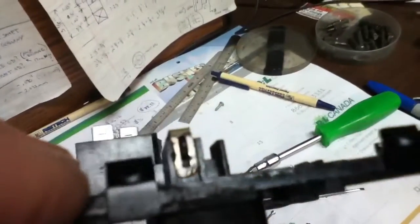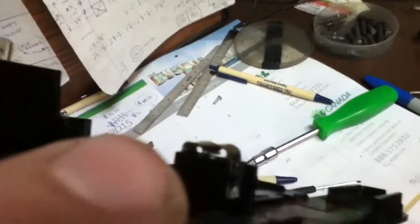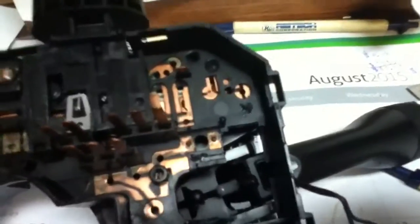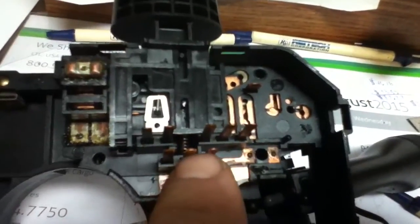In my unit it's stuck. You can see there's a slotted channel on the side for it to float up and down with the spring. Those are little contact points for a circuit. When you pull the switch out, the little lever is supposed to move backwards, allowing that spring to come up and close the circuit.